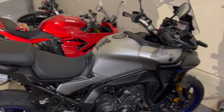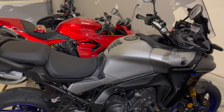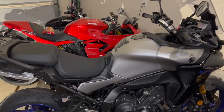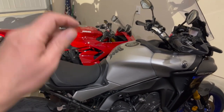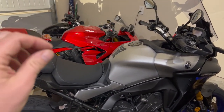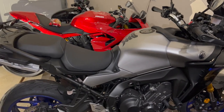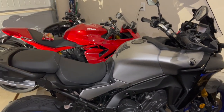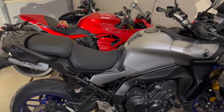The spacer kit that I have is a 6 or an 8. That spacer, that long one that went on the subframe and went underneath there, had a 6 millimeter piece, and then there was a 2 millimeter piece stuck on top. I can't imagine 2 millimeters makes a difference, but if I wanted to lower it a tiny bit, I could. But I think this will probably work.